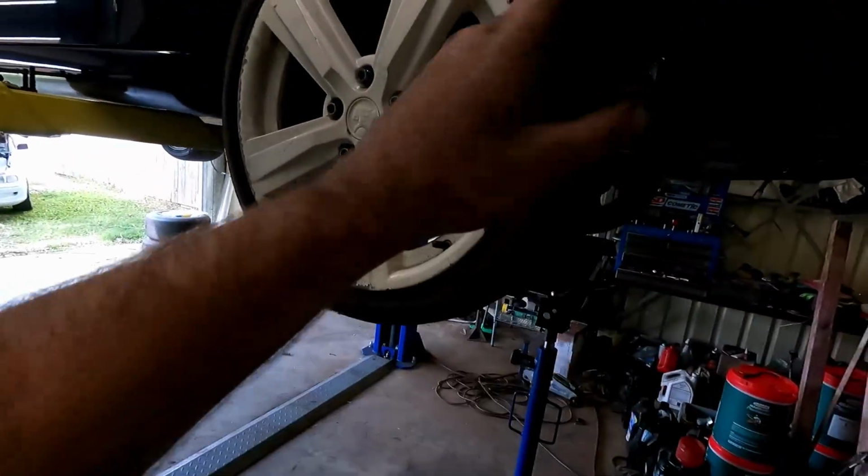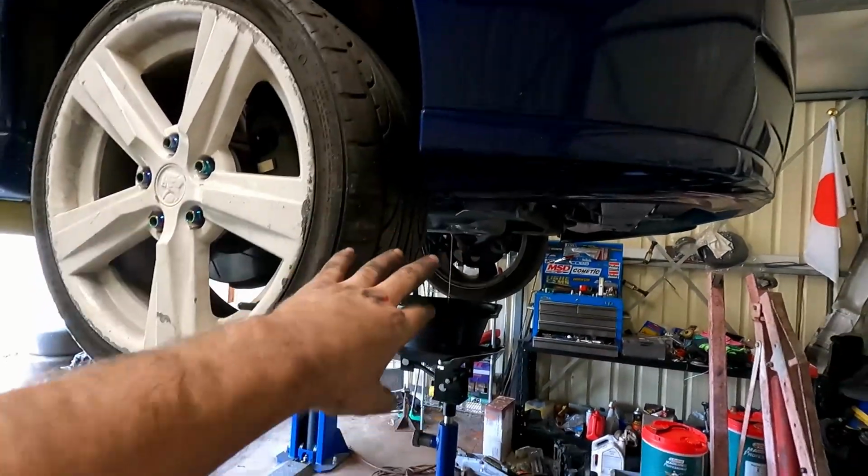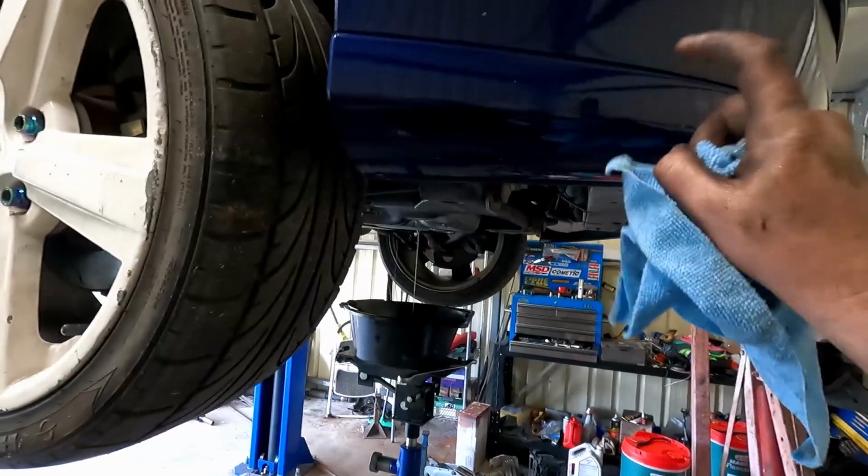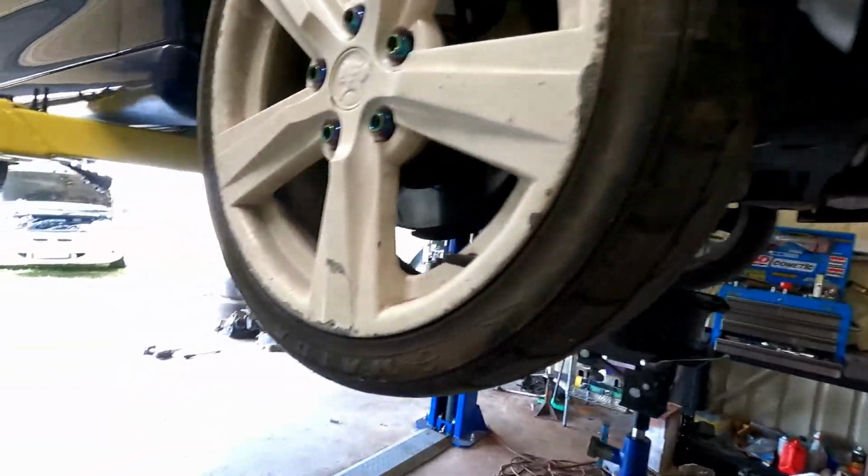Next video you'll probably see will be me yanking the engine out of this thing. While engine oil's draining, I'll drain the power steering fluid and coolant out of it, and then I'll start working on getting the engine out during the week. You'll probably see that next, and then the tear down of it. I'm going to tear down its engine on camera, so you'll get a chance to see what's inside it again. Then the rotating assembly is going away for balancing, and while that's away, I'm going to do a couple things to the block. I'll put some new Welsh plugs in it, and various other bits and pieces, but I'll go over that in the video for that.